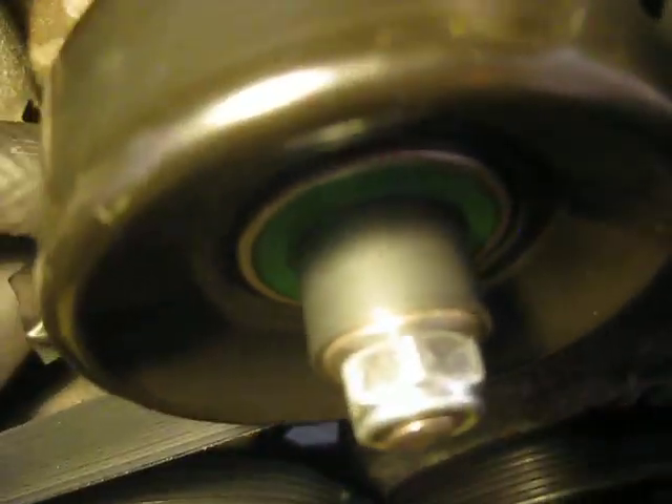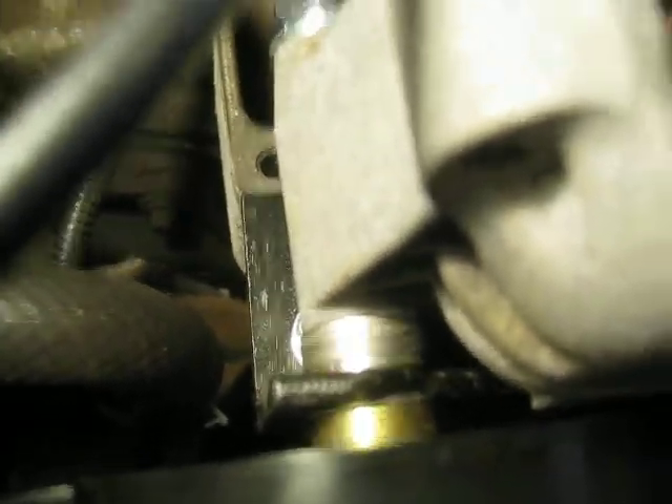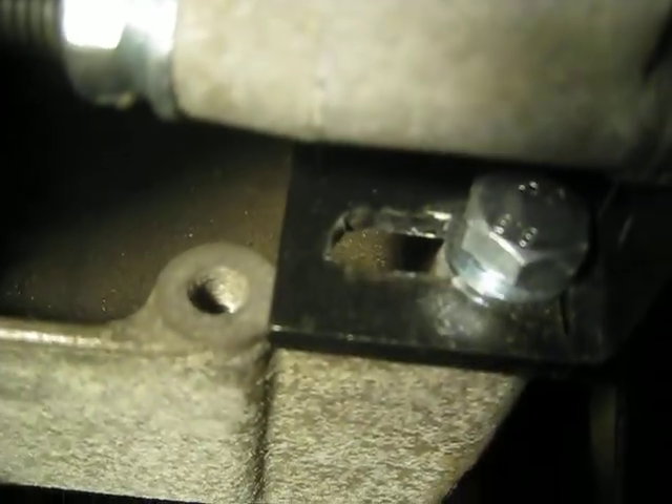That's just a bushing I had to use to get that. There's not much space in between as you can see. I had to space it back five washers because it was too far forward. There's the grooves I made — the bolt's all the way to the front so it's slid all the way back. Same on the other side.